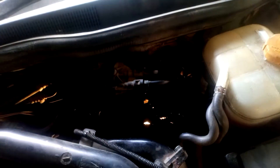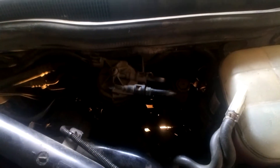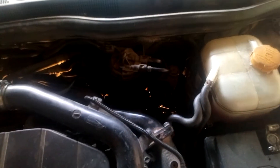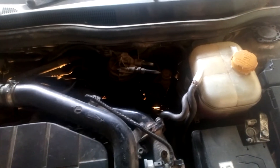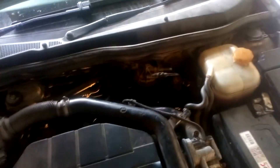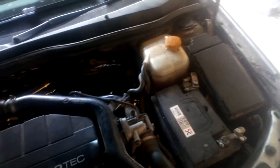This one went wrong about three days ago. I was looking for new pumps online — they are several hundred pounds. The YouTube videos said that if this car is left-hand drive you can lift the steering servo pump up without taking off the subframe, but if it's right-hand drive you can't. That's actually wrong, because I did lift this out without taking off the subframe, saving yourself a huge amount of time.